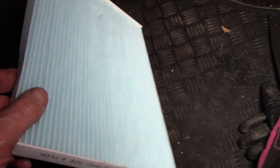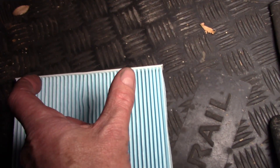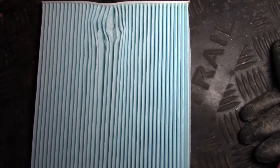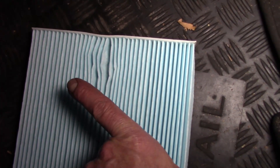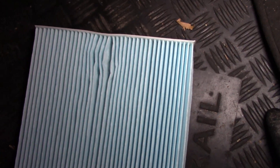Some of these later cabin filters are a bit stupid. Some manufacturers are smart enough to actually break them into two - you slide in one, pop it up, then slide the other one in. But some manufacturers expect you to fit this into a hole this big. So what you have to do is squish and compress it, shove it through the hole and let it expand out again. But it doesn't necessarily expand out to where it's meant to be simply because we've compressed it. I don't think it's a good design - these ones that make you force them into a shape that doesn't belong. I much prefer the double ones where you pop in one half, shove it up that way, then slide in your bottom half and they sit on top of one another. These nine times out of ten, you pull them out and they're all compressed or a bit squished out of shape, which honestly is not going to allow proper airflow to go past.